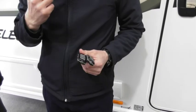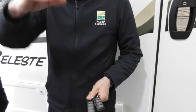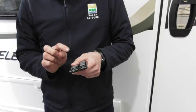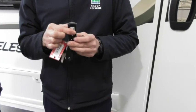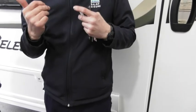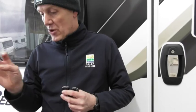PIR sensor — so it senses someone moving around inside. Or tilt sensor — so if someone's winding it up to put it on the back of their car, as long as it's set, it will trigger that off. What it will also do on this model, if you subscribe to tracker, by setting the alarm, will set your tracker. So if someone starts to move your van, it will then ping through — as long as you're subscribed — to say your van's moving, then you can get the police involved and try to get it back.